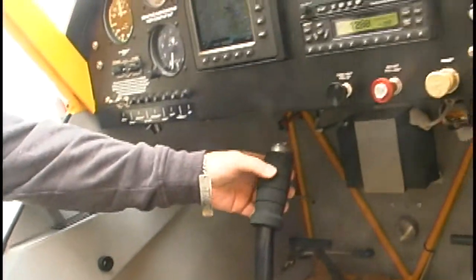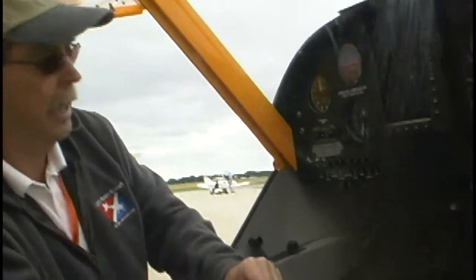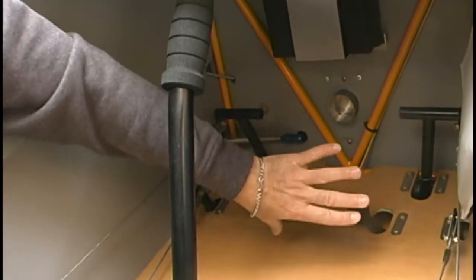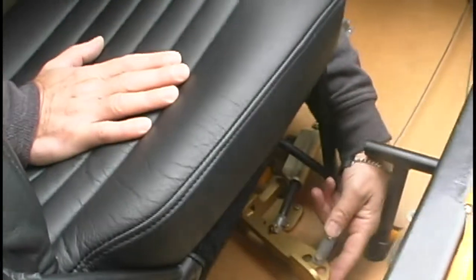What type of control systems do we use on this? You've got joysticks — front and rear in this airplane — full dual controls front and rear. Regular rudder pedals front and rear for both occupants. The rear occupant puts his feet right alongside, not in the way of the front pilot. But one thing that's kind of unique about this airplane compared to most other LSAs is heel brakes. Looking down here — they're a black fitting so you can't see them so well — heel brakes on both sides, but not just in the front; they're also in the back. That gold fitting down here is the heel brakes for the aft seat pilot, because you can solo this airplane from either seat or use it for training.